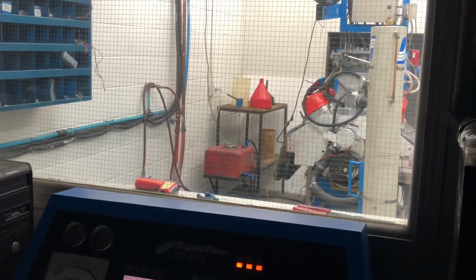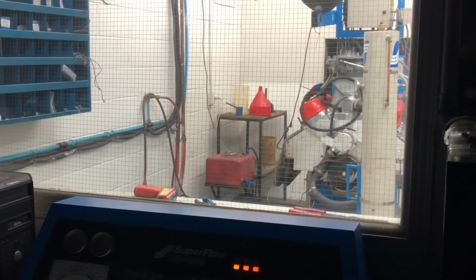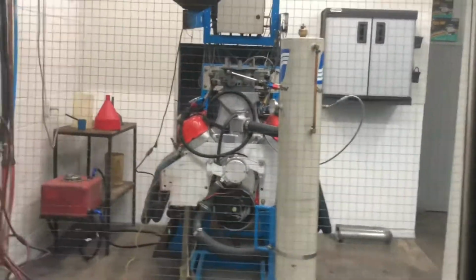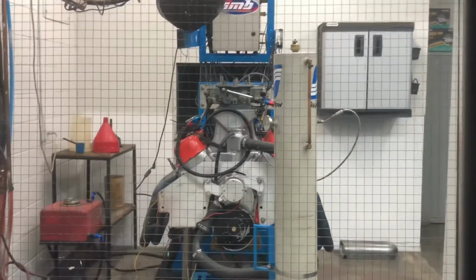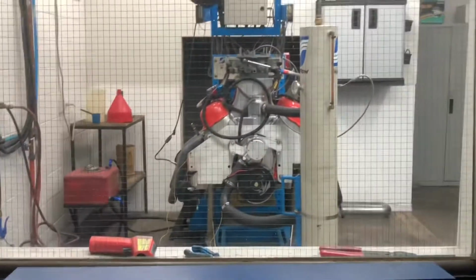Now, one thing I will say about that is we put a 400 shot of nitrous on that thing. It's gapped for a 400 of nitrous. Yeah, or more. I think Billy and I gapped it pretty good. I hope you feel good because you just spun a crankshaft from a dump truck to 8,000 RPM. I know, it's a stock crank. A good stock crank. It's a very nice forged OEM crank. Forged and nitrided, it has the black. Those dump truck cranks are actually pretty nice. It was a smooth casting and everything. And it's got good rods and good everything. But it's a 75 pound crankshaft. Yeah. We just spun a lot of weight fast.